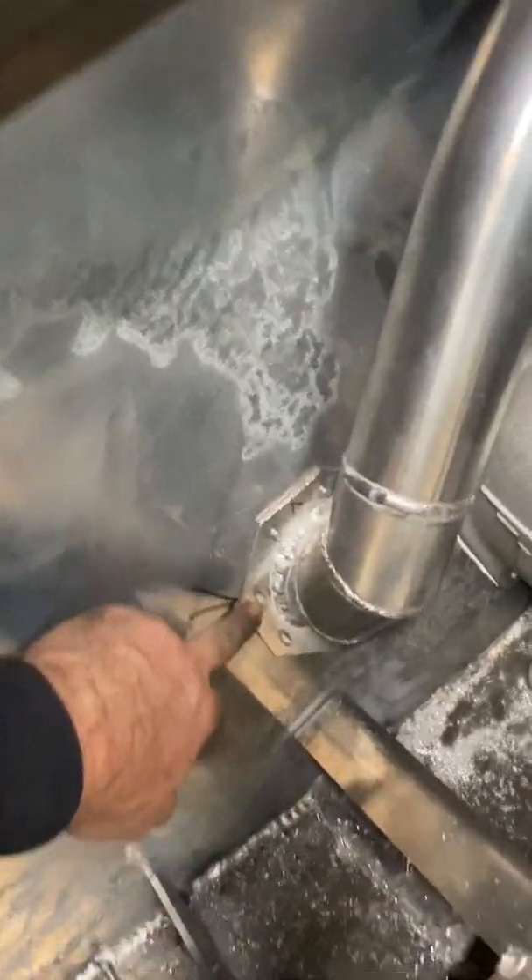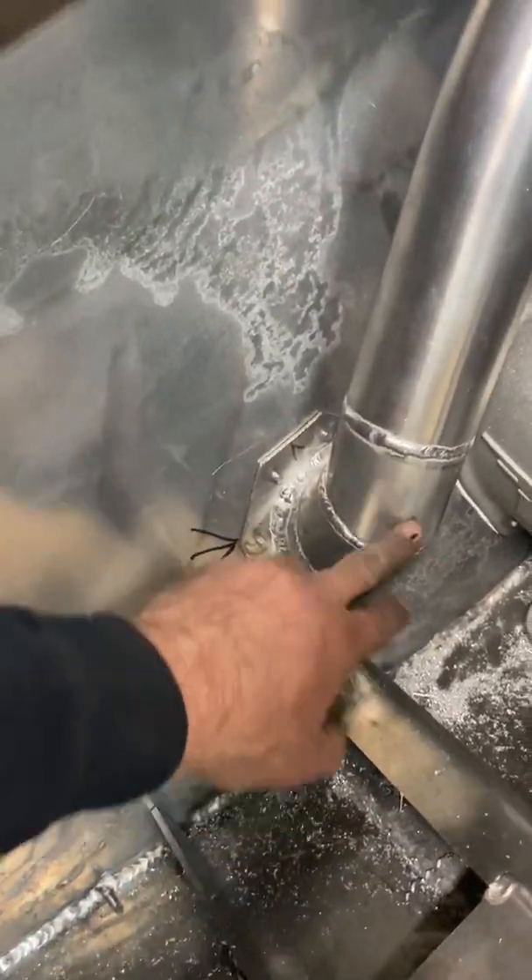A little lesson on pie cuts. I actually YouTube searched this a few years ago on a project on one of my race boats. It was a little bit surprising. So the way you do it — I want to come out of the transom 90 degrees, and let's say, for example, this one has three pies in it. So I'm going to divide 90 by three, which is 30 degrees.